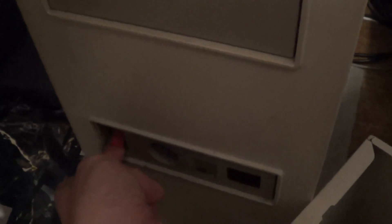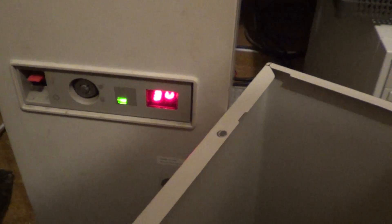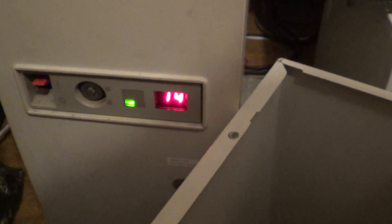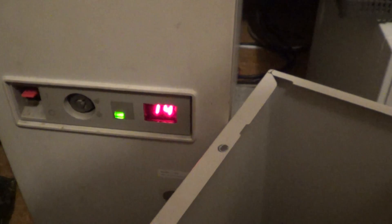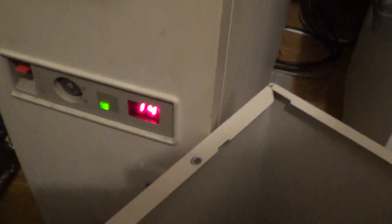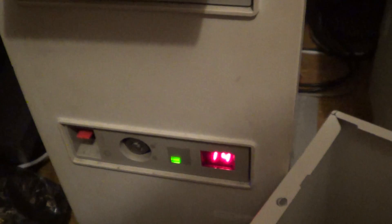Why don't we see if the 6150 wants to fire up. If you haven't seen one of these... when it hits 14 you'll hear the hard drive kicking. It's just hard to explain the size of this thing — it weighs around 30 kilos. It's still doing self-tests. It's got a 300-meg ESDI hard drive in the back with room for two more, although it really doesn't like extra drives. There's a known problem that IBM had with their 300-megabyte drives — it was very specific, so it was hard to add them.